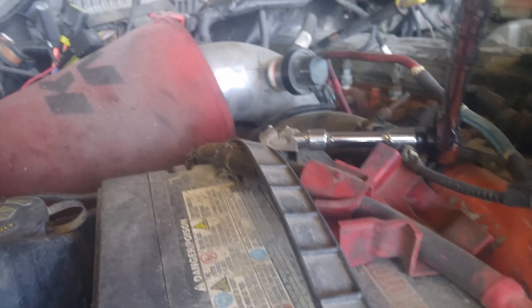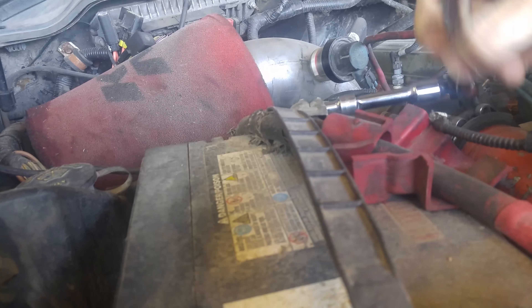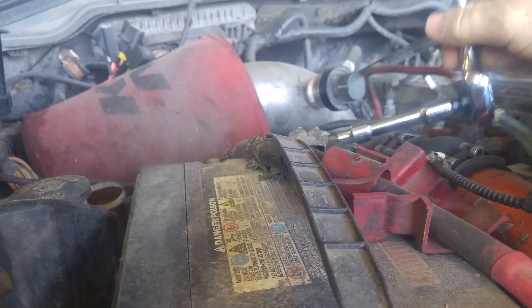Make sure the red wire comes through with it too because you're going to need it at the fuse. They provide you with a little clip on the bottom of the red wire. Make sure that when you do any wiring with your trucks, you always unhook the battery first because it plays havoc on the ECM. You want to undo the battery before you start anything. I usually always undo the grounds too — it makes life so much easier and there's less risk of spark.